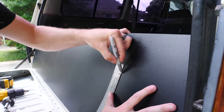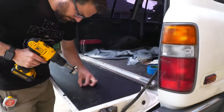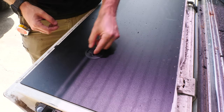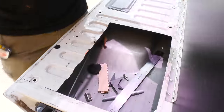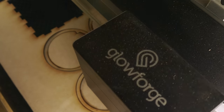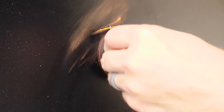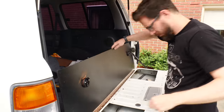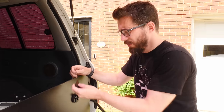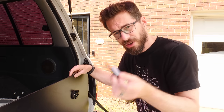After getting my measurements figured out, I used that score line as a reference point to draw the center of the hole. At that center point, I drilled a small pilot hole, and then from that I drilled a larger hole. I used a Forstner bit for this because it needed to be 2 1/8 inches. I went ahead and drilled from the top side, just in case there was any tearout, I wanted to hide it. While I was getting these holes prepared, Josh designed a couple of small rings and cut them out on the laser cutter to act as spacers. These fit right underneath to make up the difference in thickness that this latch was expecting. But they're just spacers, so you could totally cut these out of any material and use any scroll saw or jigsaw to make them.